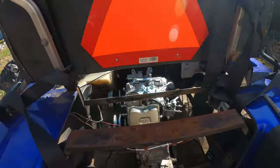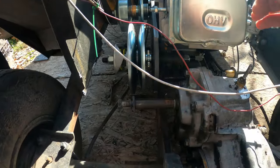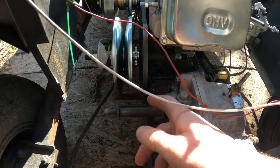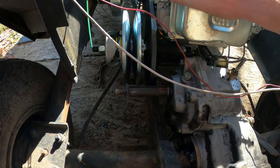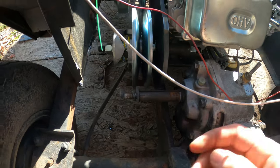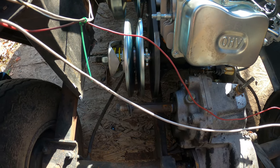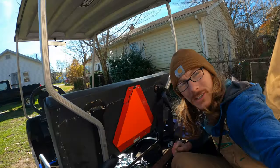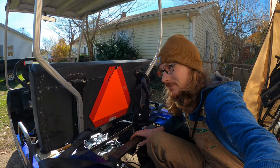It's day two on the golf cart project. This morning I've worked on the engine plate and got it to sit where I want it - it's not welded yet but I had to do some trimming, had to cut off a corner of the plate. Now the engine will slide back and forth to allow me to tighten up the chain running from the jack shaft to that sprocket. It's going to be a real short chain. My plan is to get the sprocket to mesh right up in here - maybe a 14-tooth, ordered on Amazon. Going to be playing with the gearing a lot. Next step is to get the plate welded in, make sure it's nice and true and square, then start dressing up the engine.